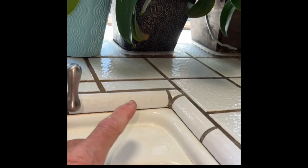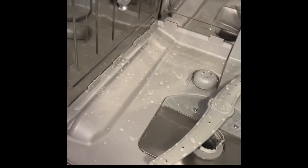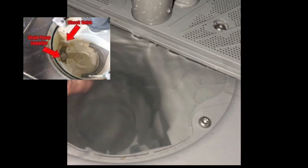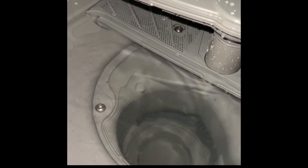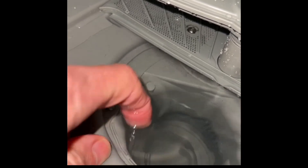So it's either a clog right in the filter area, somewhere in the drain line itself, or if you have one of the air gaps — very common — it'll be caught inside the air gap. With these modern Bosch dishwashers, that little white impeller cover we looked at is a very common problem. On the older Bosch dishwashers, when you remove the filter, to the left there's a little plate with a Torx 15 screw. Remove that, pull the plate up, and there's an impeller right there — make sure it can move freely and the plate is put back in. But on the more modern Bosch, it's very common for that white impeller cover to come loose. Just press it in until it clicks and that should solve the problem.